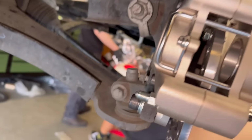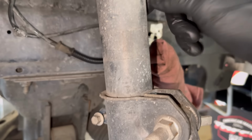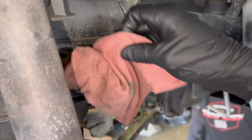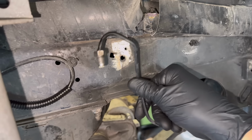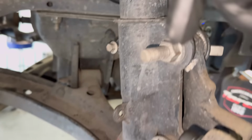We are now going to connect the brake line. Oh, I guess it came with banjo bolts. So now I have extra banjo bolts. But now we're gonna go from here over around this guy. I'm probably gonna tie it up to here somewhere out of the way. And then it's gonna go to this factory line. This was self-tapped into here, so I gotta figure out some way to mount this up. I'm probably gonna make a bracket at some point, but for now we're just gonna mount the line to the caliper.